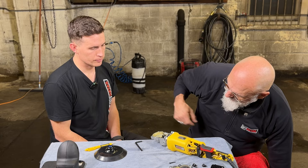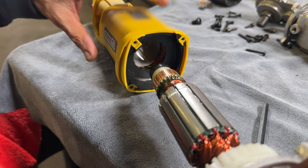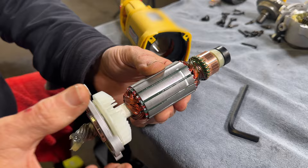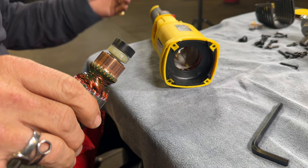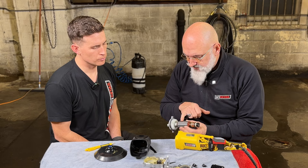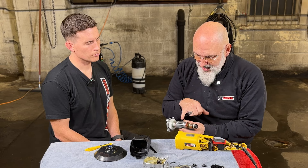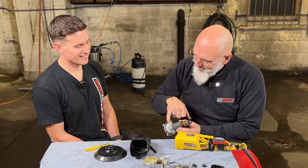The gear case comes off as a separate piece, and now you have the gear on the spindle with another bearing visible. Splitting it apart, we have the rotor of the machine. You'll notice the fan — it's not a straight cut, it's a helical cut, designed to get more airflow. The airflow in this machine comes in by the brushes, cooling them forward, and comes out of the bottom of the machine, cooling the pad area. This is a precision-balanced rotor — you'll notice balancing marks. The windings are properly sealed. Our fan is extreme for the industry — a lot of fins on the fan moving a lot of air, even at slow speed.